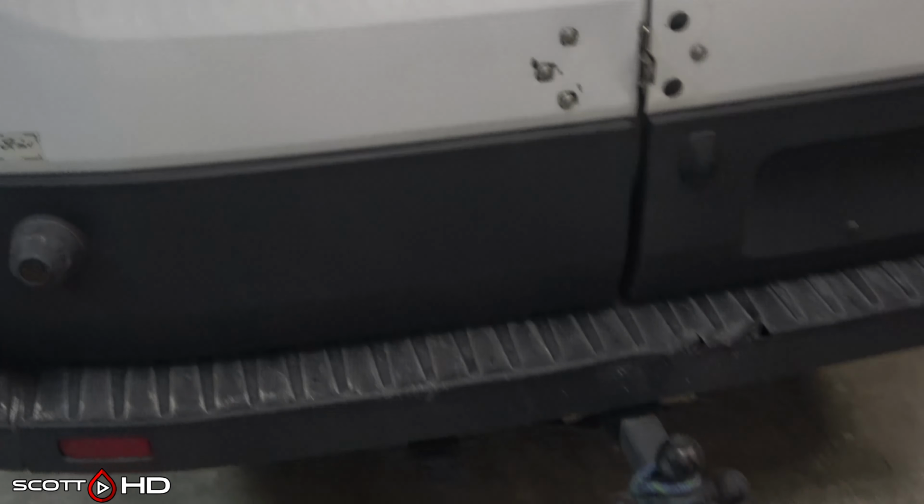Jumping right into it, we're first going to debadge everything, and we'll first try the cheap route: Turtle Wax label and sticker remover, available in the video description and also at your local parts or big box store. You also need some decent tape and some plastic trim or pry tools with a thin but strong edge. Mask around the emblem you want to remove, and gently pry against the tape to remove it.